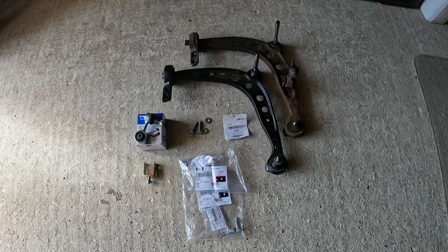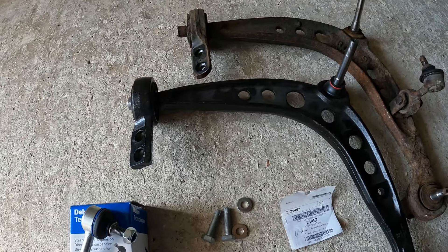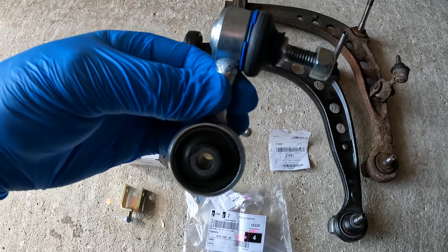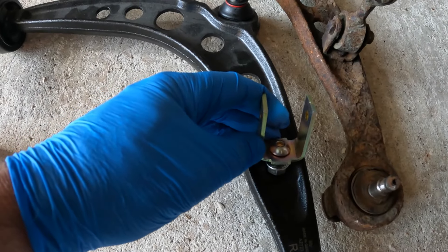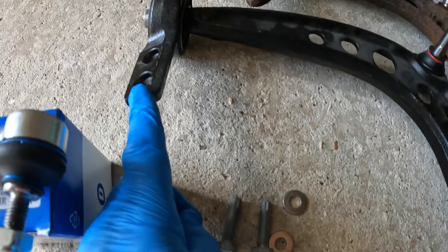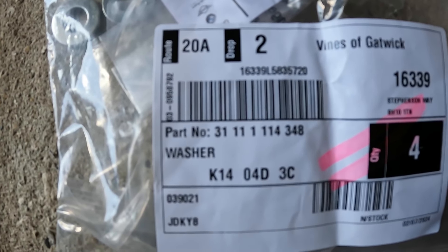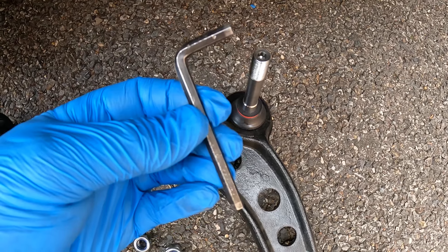Let's take a minute to talk about parts. The original arm is absolutely knackered, so here's the new one from Febi-Bilstein. I also have the drop link — this is a Delphi component. Then there's the bracket which goes through the arm — I got these from eBay because the originals are silly money, and these look well made so I bought them. And then the bolts and washers for this. I will leave all the part numbers in the description. We have the two new nuts, and just in case we do have to hold the inner steady there's a 6mm allen key.